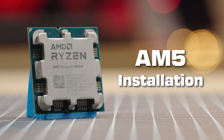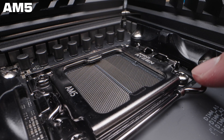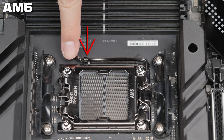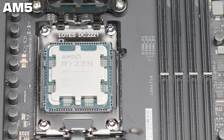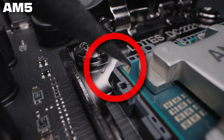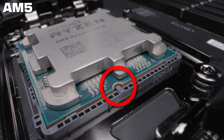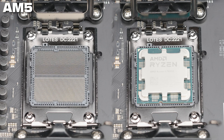Next, let's install an AM5 CPU. The AM5 socket looks a lot different than the AM4 socket since the AM5 is an LGA type. The socket pins are surrounded by a retention bracket that holds the CPU down, and there's a small lever on the side of the socket that keeps pressure on the retention bracket holding the CPU in place. Check the orientation — there's a small triangle on the corner of the retention bracket and a corresponding triangle on the CPU. When you raise the retention bracket, there's also another small triangle on the socket plate so you can see the CPU and socket triangles line up when inserted. There are two small notches on the top and bottom of the socket with corresponding indentations on the chip, and these notches are off-center so there's no way for the CPU to go into the socket in any other direction.